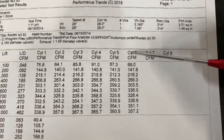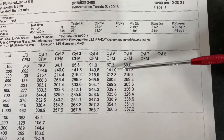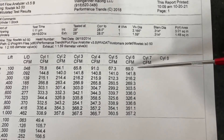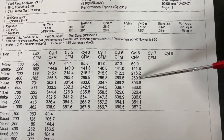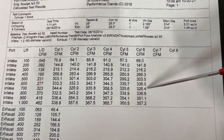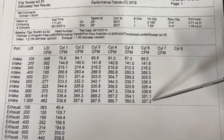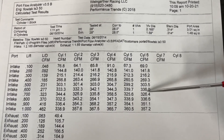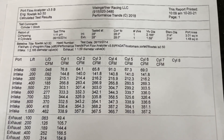This is the 50-degree port - before I laid the short side back, after laying it back where I destroyed it, and then after adding that modeling clay. The clay looked horrible and you'd think it would hurt flow, but: at 200 it's slightly better, at 300 noticeably better, at 400 almost nine CFM better - that's a pretty good gain - and four CFM better at 500. It's slightly lower at 600, slightly above at 700, about the same at 800, three CFM worse at 900. Overall for the most part it's better, and that was the highest number I'd had at 400 lift.